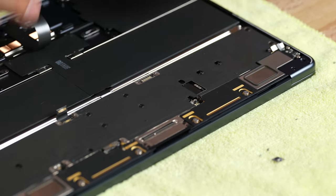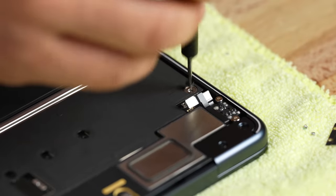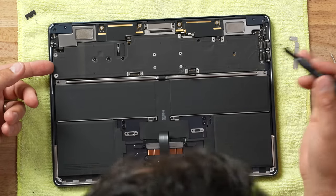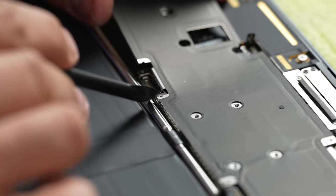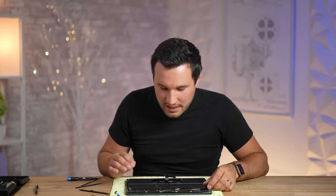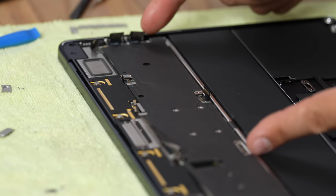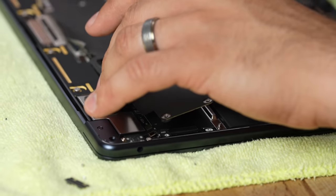That was a lot of tiny screws and ribbon cables with covers. Now we can actually unscrew the whole motherboard and the plate. We have some smaller screws in the center and then some larger ones on the outsides. It looks like some of these screws are holding the cover — for example the ones in the back — now it's literally lifting up, while other ones are holding the motherboard down to the chassis. It looks like this is a dual-layer cover: two separate parts of metal, some of which just grip onto the side. We lifted up this whole section but then it doesn't really want to give, and we don't want to risk damaging any thermal things or heat spreaders. It looks like the motherboard is actually only this small section right here.